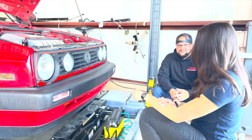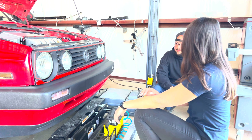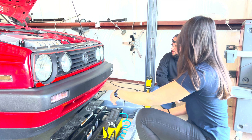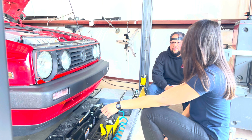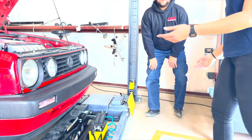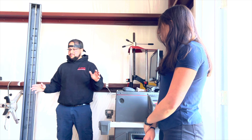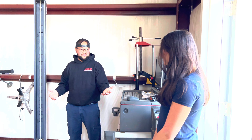I literally just wired fog lights, headlights, running lights, and turn signals — just the basics to get out on the road. My fog lights are wired to the inners, but because I put LEDs in the main headlights they don't work — normally they're grounded through the bulb. You know all that? Yeah. You learn eventually after doing it so many times — you pretty much know the car from bumper to bumper.